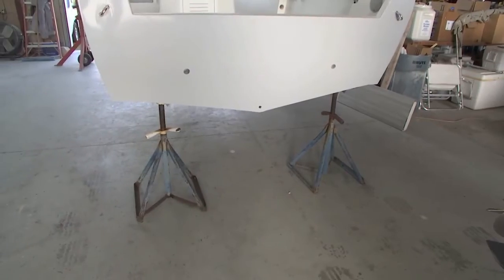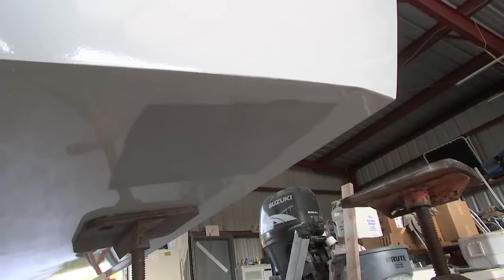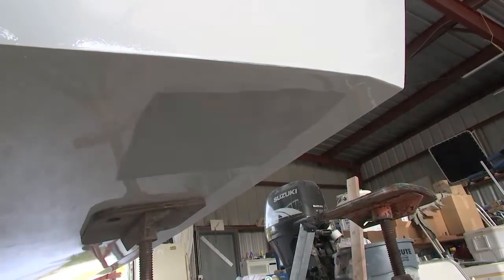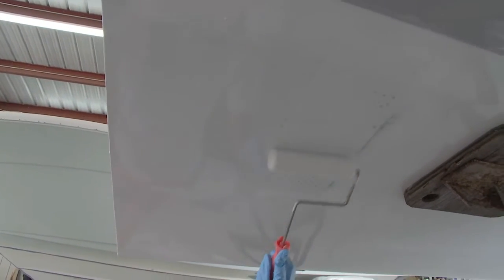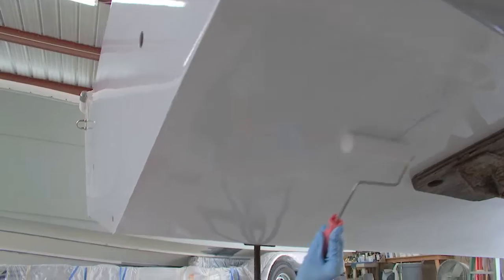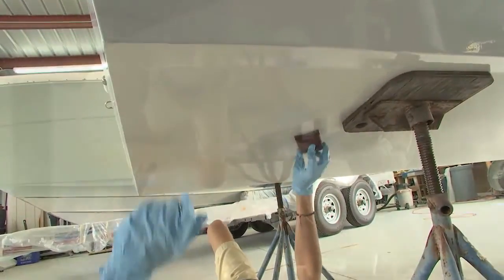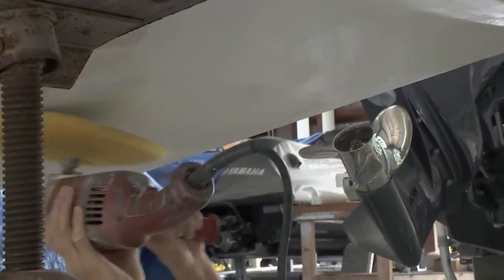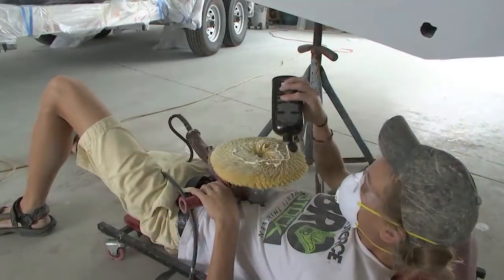We have two jack stands, and a lot of people painting their hull bottom will have the boat supported in the air. We'll paint around those, let the paint cure, then move them — but we'll have to paint where the heads of the jack stands were, and sometimes you get a line there. This is a blendable paint — how can we get that line out? Very easily: start with wet sanding with 1500, then follow with a buffer using a wool pad, a 3M marine compound or Farecla Profile 300, followed by a finishing compound.